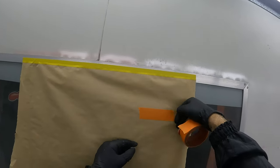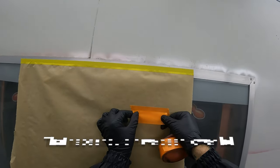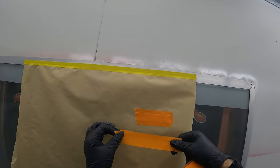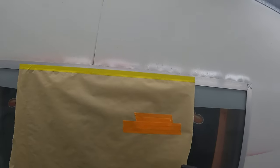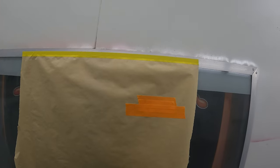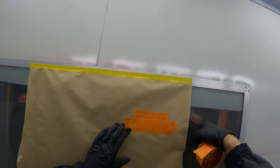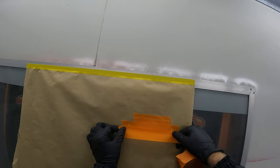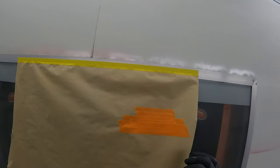A 50% overlap means your next pass of the spray gun goes 50% down — half covering what you've just put down. If you're doing a third coat, you go half again. That's representing 50% overlaps. If you're painting candy, that's a 75% overlap, which looks like this — you're getting a lot more paint in the same area because candies are very transparent and you need coverage for it to look the color you want. That's a rough example of what overlaps are.